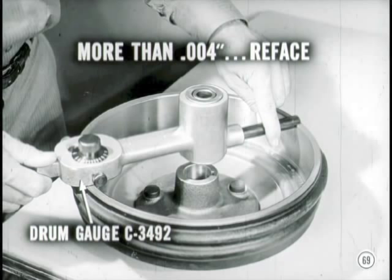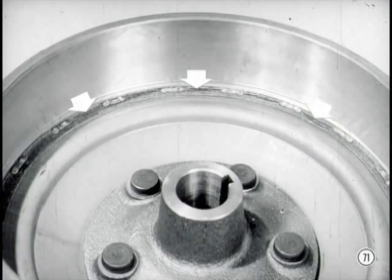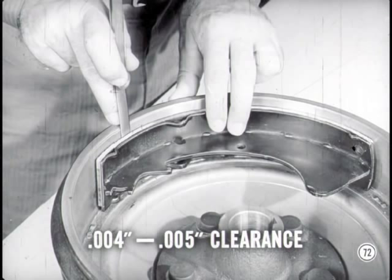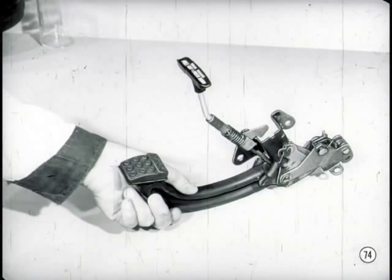Anything else, Bert? Yes. Always check the drums for roundness using this gauge. If they are out of round more than four-thousandths, refacing them will help you do a better brake job. If you need to take out more than thirty-thousandths to true up the drum, don't do it — that would increase the drum diameter sixty-thousandths. Replace the drum instead. If you should notice any hairline cracks in the cast iron part of the drum near the back, don't be alarmed — that part is fused to the drum and the cracks won't affect the life or operation of the drum. Measure the clearance at the ends of the shoes in the drums with a feeler gauge to be sure there is four to five-thousandths clearance. Be sure to inspect the wheel cylinders to see that there are no worn or leaking parts. And before you put the shoes on the dust shields, lubricate the platforms lightly.